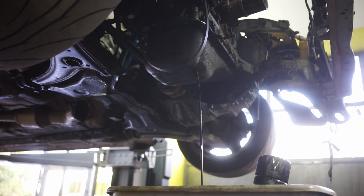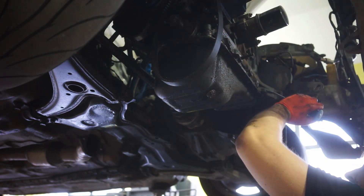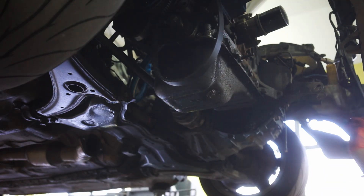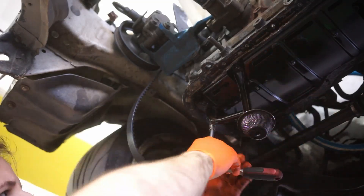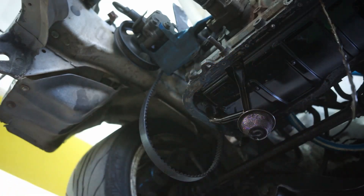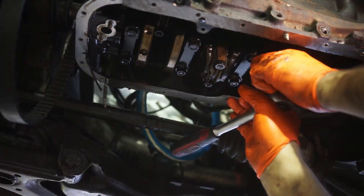You can already see there is a lot of oil on the bottom of this engine. That's because the front main seal was leaking quite badly, and the oil pan was also leaking very badly. So it makes sense to put new gaskets and a new seal in there, so we don't leak oil everywhere — especially not onto the exhaust. The complete underside of the car is covered in oil, so I guess it won't rust, right?